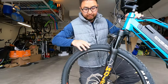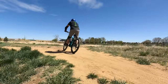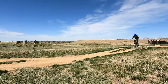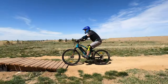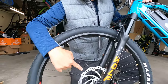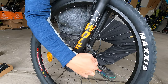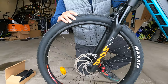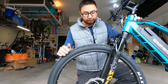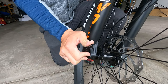Up here we have 34-millimeter suspension designed specifically for e-bikes, since a lot of suspension is only designed for mechanical bikes. This one is 34 millimeters with 120 millimeters of travel, where you can adjust the air suspension and lockout. There's a 203-millimeter brake disc with four-piston hydraulic brakes — two pistons pushing from each side — giving you really good stopping power. We're used to seeing e-bikes with only two-piston brakes, so four-piston is far superior. There's also a quick-release for the front tire requiring no tools.